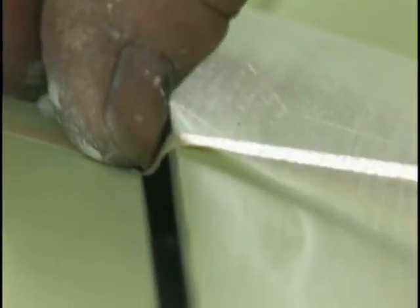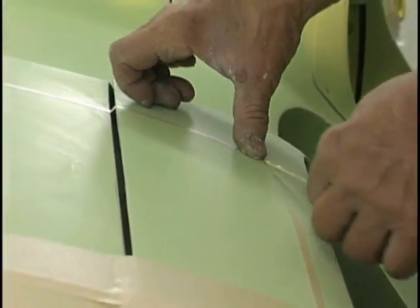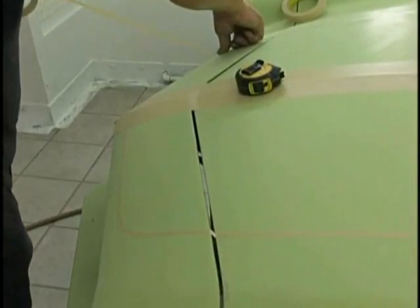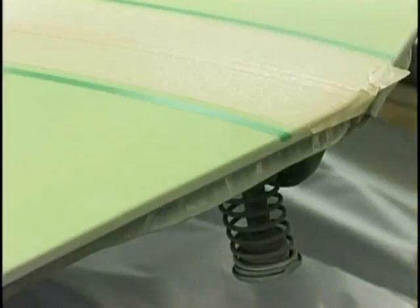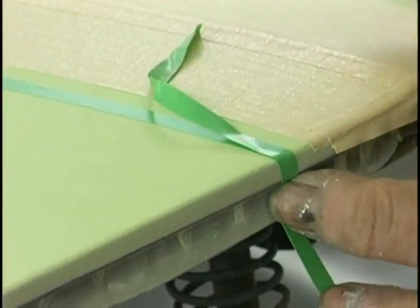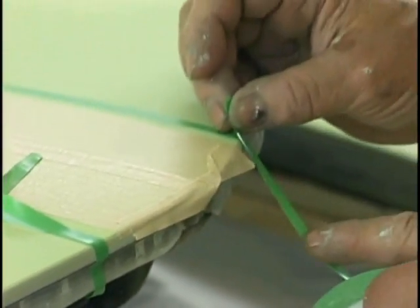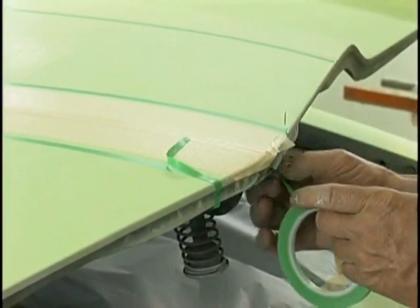Now, when we're crossing a hood opening or a door opening, you can also come in and pop the hood open and tape those edges so that the design continues through the open hood. This really shows fine detail, and that's what we're doing here to make sure that our design goes through. You can also do that in the jambs if you're being paid for it. It does take extra time, and the customer has to understand time is money.